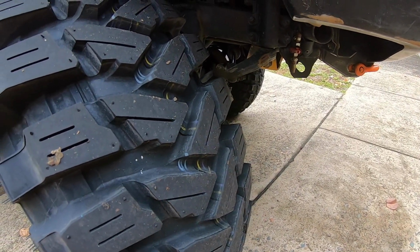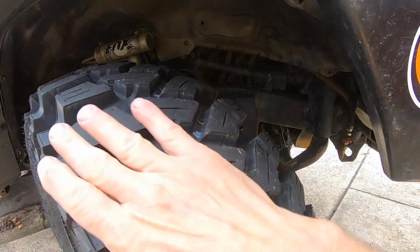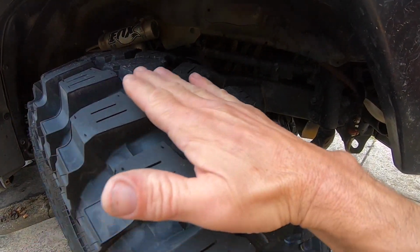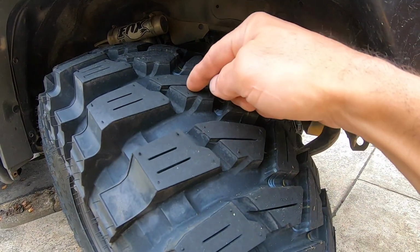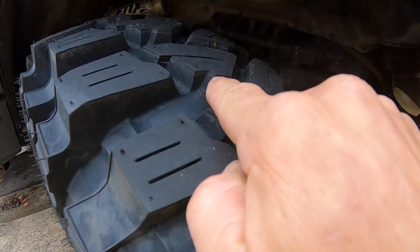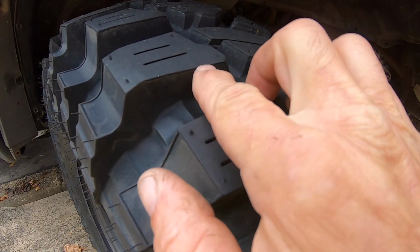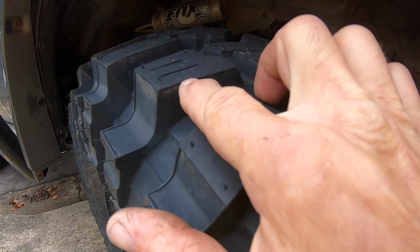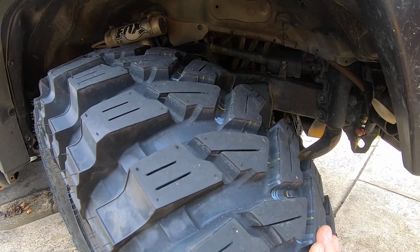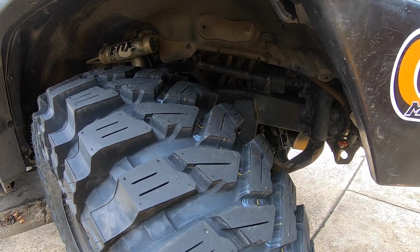I thought I'd be skating a bit more with no sway bar especially, but they've handled well. Quite rounded. We've got 36 PSI in them and they're not a flat surface, so you're on the road more in the center lugs. You can see here the wear mark on those two lugs, as opposed to this corner block which isn't getting much road use. So I don't know if that means I've got to air these down a bit more, but it'll be a good test to see how much we take off in the couple of thousand Ks that we put on them.